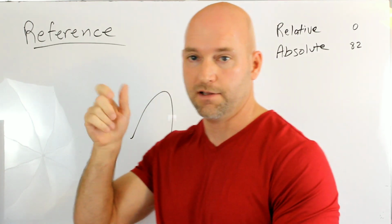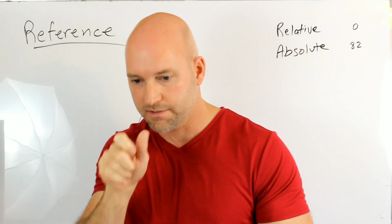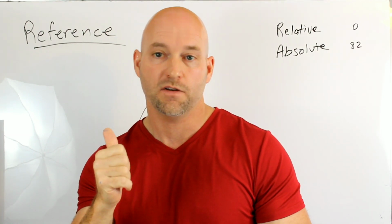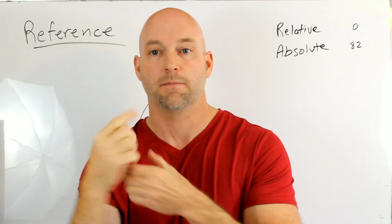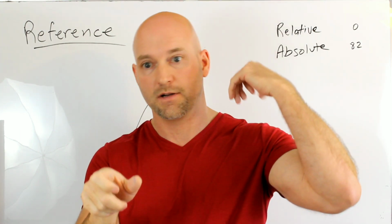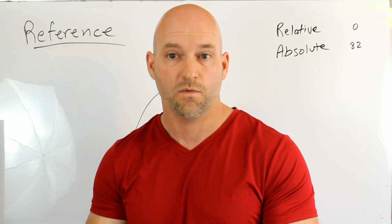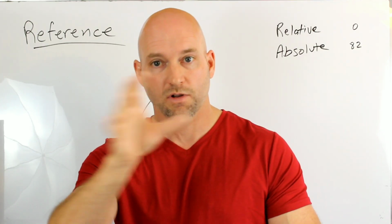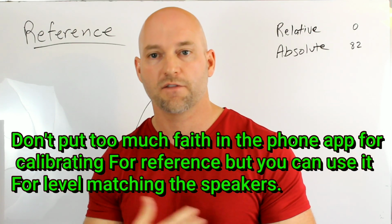Now, you can stack up some pillows and just set it there. But remember, you want to aim it at the speaker. I wouldn't just leave it straight, especially when it comes to the speakers behind you. Or aim it straight up. If you can do that, that's even better. Just aim it straight towards the ceiling, and that way all the speakers are going to be hitting the mic kind of equally, instead of some being pointed at the speaker and then your rear speakers, the mic's pointed away. You can also use a phone for this. Even though phones are not accurate, the inaccuracies are going to be equal in all speakers. So you can use your phone app and find an SPL meter just to verify.